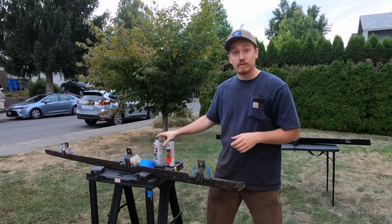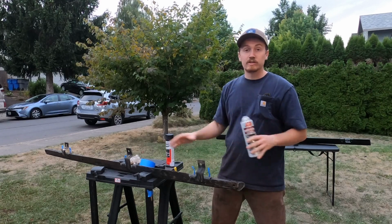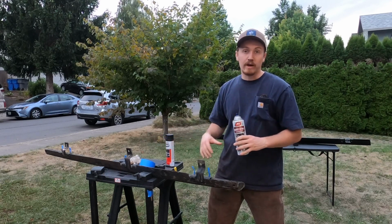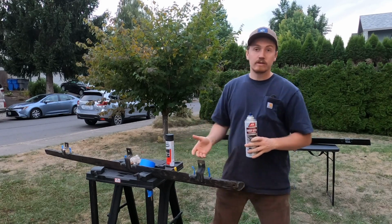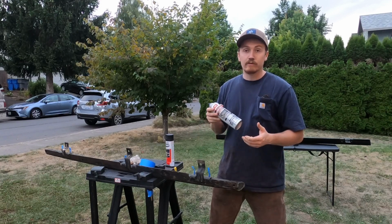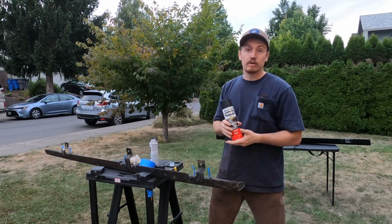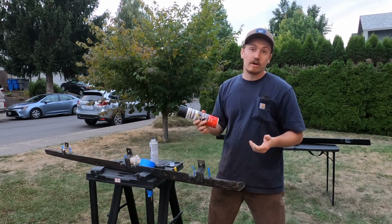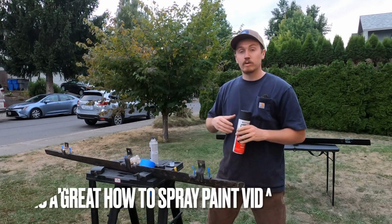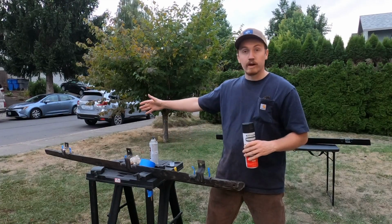So the next step that we are going to do is we're going to be hitting it with some Rust-Oleum Rust Stop, and this is going to be used as the primer base layer, because as much as I've tried to clean this, grind down the sand, grind down the rust, get all the pitted spots of the bad stuff that we're attempting to eliminate here, this will help prevent it, conceal what's still in there, and give the Rust-Oleum bed coat a good spot to bind onto, and hopefully give it the best chance at lasting long and looking good. So it's getting dark. You guys know how to paint, I hope. So I'm going to hit the primer, a couple of coats, then hit this bed liner, and you guys can see me tomorrow morning with what we've got.